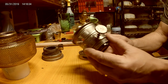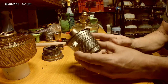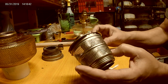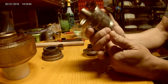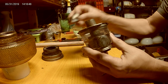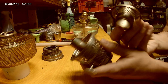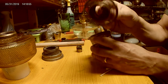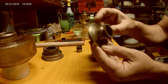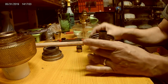This is a Model B burner, very similar to the new-style ones. Here's the anatomy: that's the burner basket, this is the inner wick tube that the flame spreader sits in, and the wick travels up and down this inner wick tube. Then we have the outer wick tube. The outer wick tube is pretty symmetrical except it has one cutout on one area that's wider than the other, so it only goes in one way.